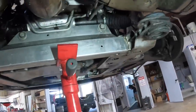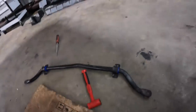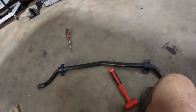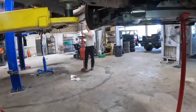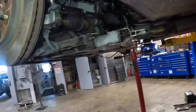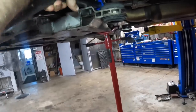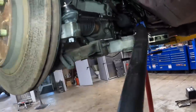Okay, we're about ready to get this sway bar installed — a set of new bushings is installed. I still do not have the end links yet, but that is of no matter because later on those control arms are going to be removed, so I can put the sway bar links on when I get the control arms reinstalled. That being said, let's go ahead and get the sway bar in position behind the steering rack. We'll get her bolted in, and then we'll put the rack up permanently. At that point we can move on and get these control arms replaced.